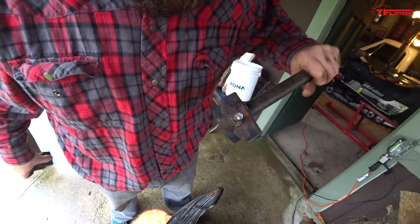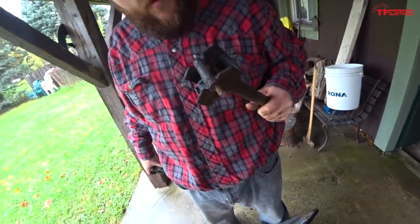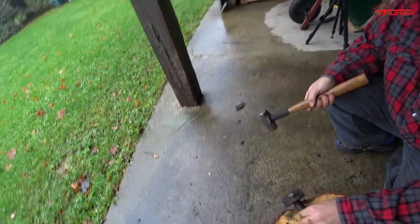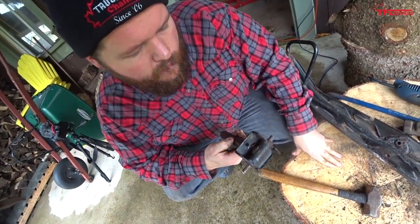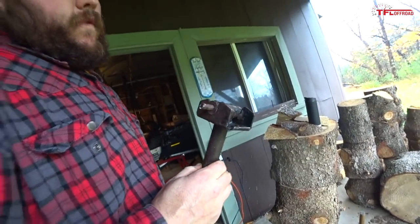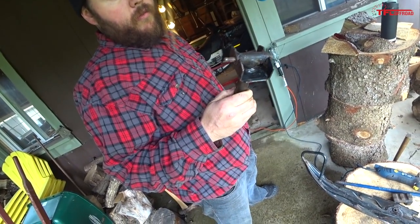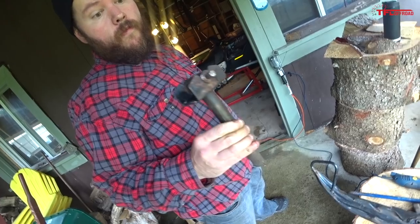Man, well now we gotta get that bolt out of there because we can't reuse this arm unless she comes out. So let's just try hitting that with the hammer and see what happens. No. Because it's so in there. So I'm going to cut those off flush. Why? Drill it? Take them to work and drill them. Or maybe we'll put them on the drill press. And I'll just have to order new bolts and new bushings. Yeah, maybe we don't have a choice.